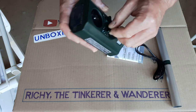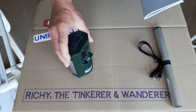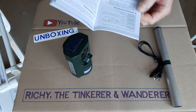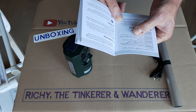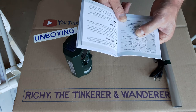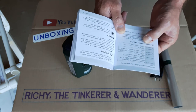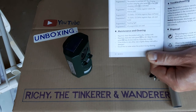On the front you've got sensitivity and frequency controls. The frequency selector has an off position where the unit won't emit any sounds. It's got quite detailed instructions — Lidl always give you a nice detailed instruction booklet. There are four different programs: program one is 13.5kHz to 17.5kHz against rodents like mice or rats; program two is 15.5 to 19.5kHz against dogs and foxes, which is what we're going to try; program three is 19.5kHz to 23.5kHz against dogs, cats and birds; and program four is the flashing light.